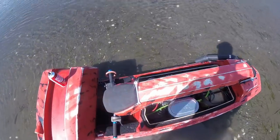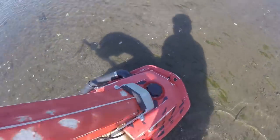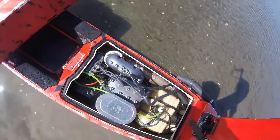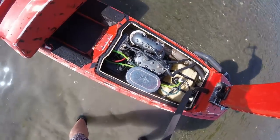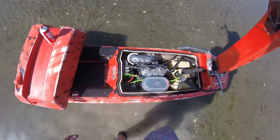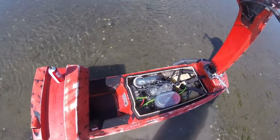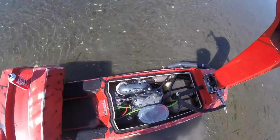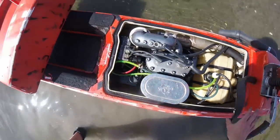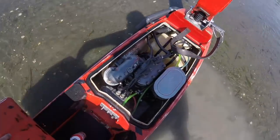All right, I put a filter on this thing. Got the, uh-oh, dropped my wrench. Now, this is one of those dual K&N filters that I bought for, I think, one of my SXR engines, and it doesn't really fit those at all because the spacing's narrow for a 550. But this has the same bore spacing as a 550, so it went on these carbs perfectly, and it looks like the hood's gonna still fit on there. But it looks pretty cool in there.